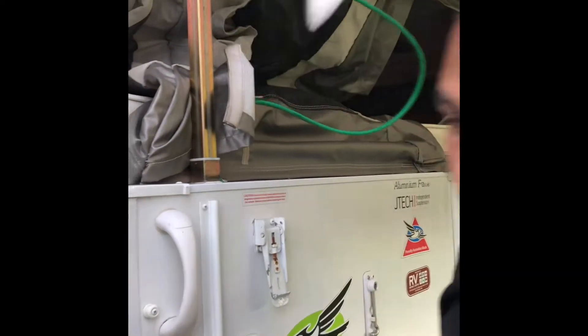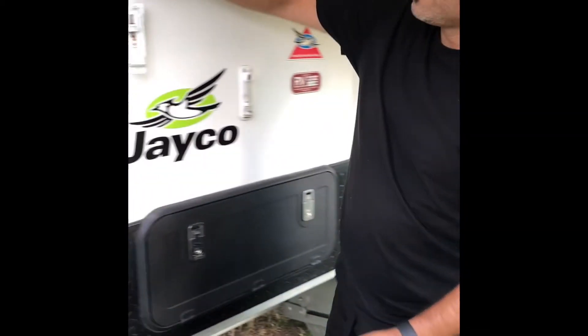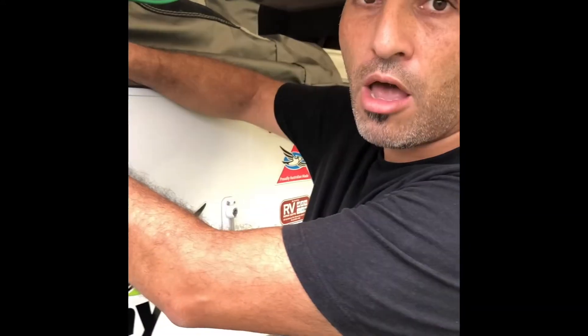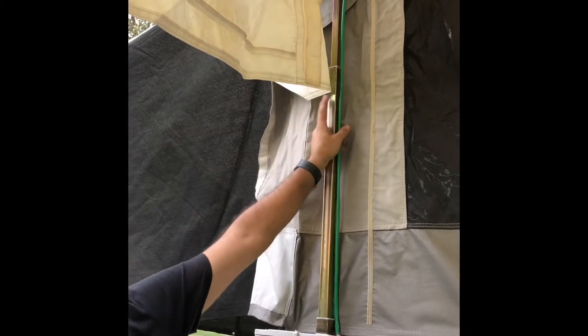Now we're ready to continue raising the van up - keep winding clockwise. You'll see this green tension rope; you want that to be reasonably tight but not really tight. That's the indicator for when you've gone up too far. As you're raising, check both sprinter poles making sure they can lift, particularly the ones in the annex. Also watch the white washers on each of these legs - if these come out, stop what you're doing. They've got to be re-lubricated and put back in. Jayco's manual warns these are critical; if they come out you wreck the roof. Make sure the pole is sliding out of these nicely with no bending. Once there's plenty of play but it's taut, that's enough - don't go any higher.